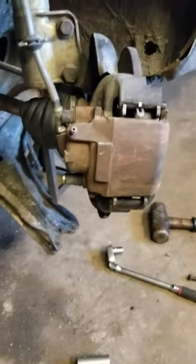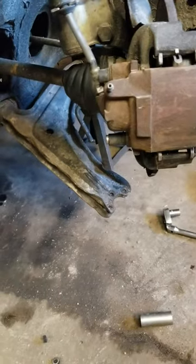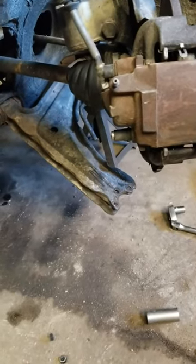If you've got any questions about the build or anything — it's pretty simple to do the ball joints on here. You take your center carriage bolt out, tap the control arm down, take your three bolts out, and you're set to go.